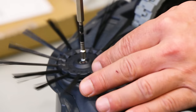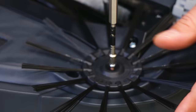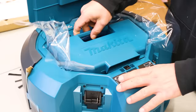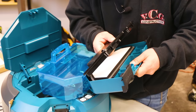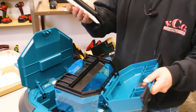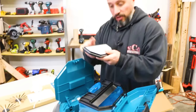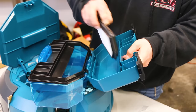We place our two side brushes — there are screws with pre-applied thread lock, just snug them down. There's some tape here that we're going to remove. We lift up the lid — it holds open nicely. We pull out the foam and pull out our canister. Here's the inlet and on top is the filter. We pull this up and the filter pops out. This pleated filter is obviously a lot bigger than the filter for my Roomba — literally like four times the size.